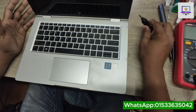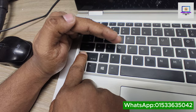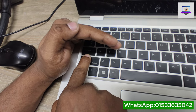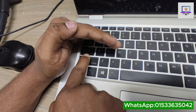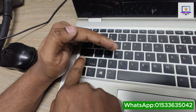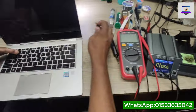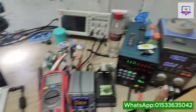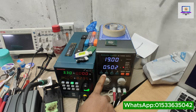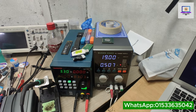Let me show the problem. I connect my power supply and as you can see, it's turning on — one, two, three, four, five — now it's turning off. Let me show the power supply: as you can see it's taking only 0.32A. When I connect the power supply to this laptop, it's taking 0.5 to 0.8A or so as it turns on.